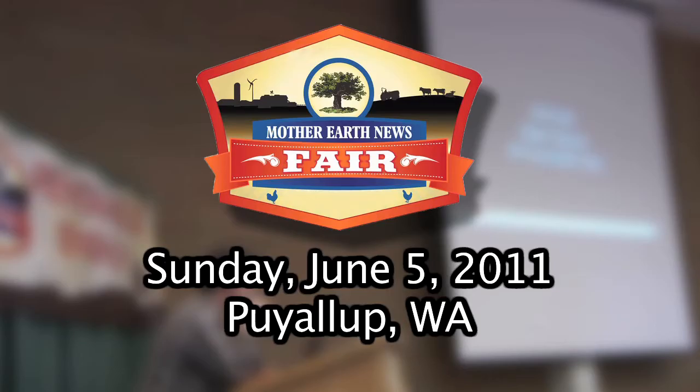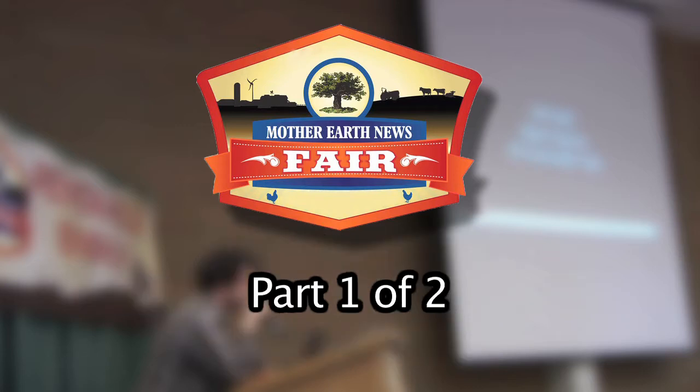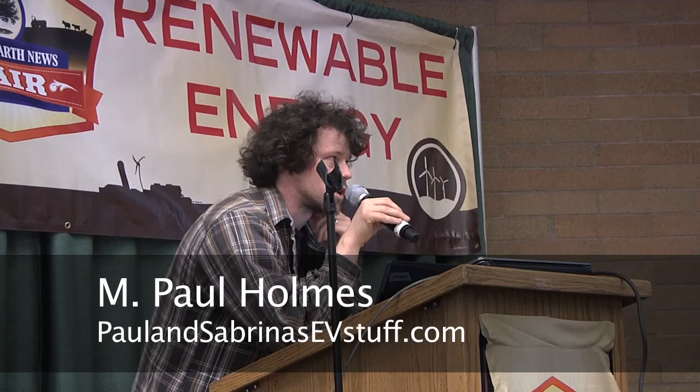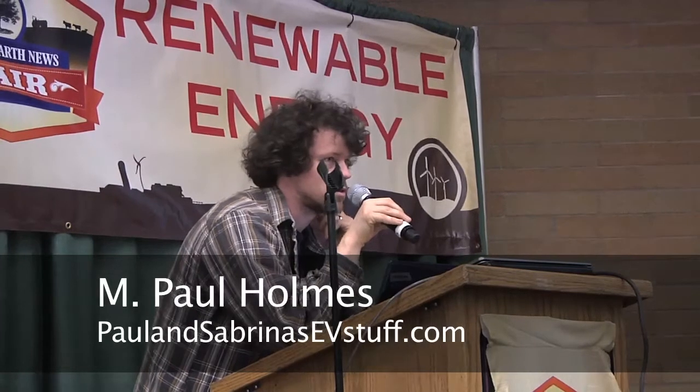Here's a typical cost breakdown of this power level — 144 volt, 500 amp, that's around 100 horsepower, which is enough to get freeway speeds. A Curtis 1231C — you can get them for about $1,600 new, or around $1,200 for a 10-year-old one. They're just expensive.